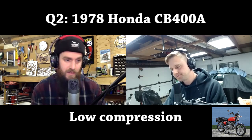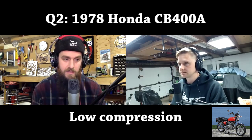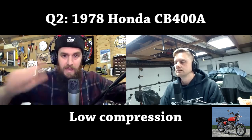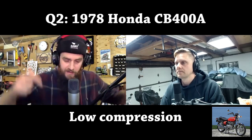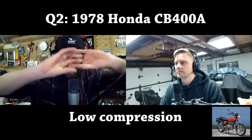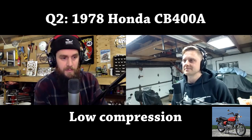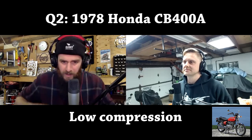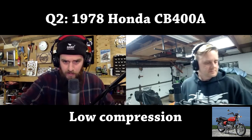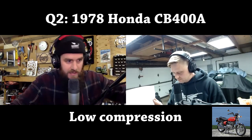Yeah. There's nothing to do with your transmission. I don't think it has anything to do with that. There is on that carburetor a fast idle throttle linkage. So when you shift it into gear, Matt, it bumps the RPM up, but not enough to allow the motorcycle to roll. So it kind of kicks the RPMs up. And once you give it throttle, it functions this lever on the carbs and it functions both carbs. It's kind of like one's operating before the other. It's kind of interesting. I've never worked on one of those automatics. It's a pretty interesting unit, but I think he has, I mean, what did he say? He said that it has been sitting for years in a carport, essentially stock. So yeah, again, I'm really leaning towards carb related.